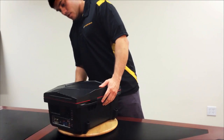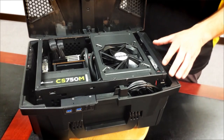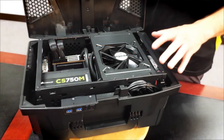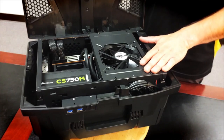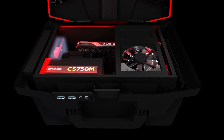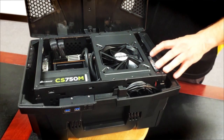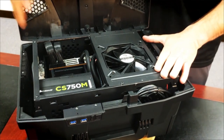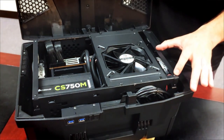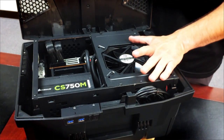Now we'll open the case and talk about some of the internals. Inside the FANG BattleBox there's actually an internal frame wrapped in this box, which would normally present some thermal challenges. We've combated those by inserting plastic baffles to compartmentalize the heat, and then by strategically placing fans and vents we expel that heat from the chassis — it's actually even more efficient than it would be otherwise. There's a 120mm fan mount in the back, a 120 or 140mm on the top bracket, and an additional 120mm in the front. You can also use a liquid cooler on the CPU.